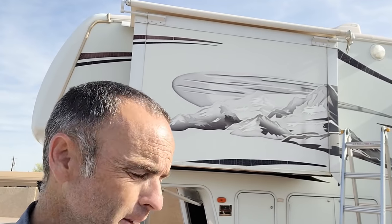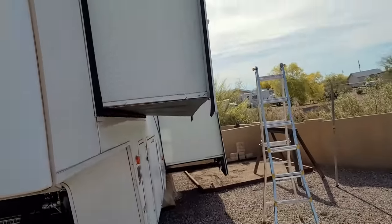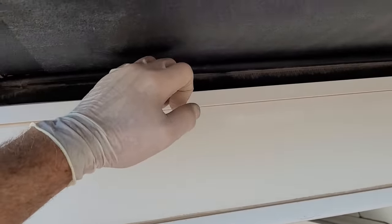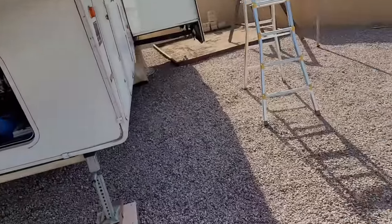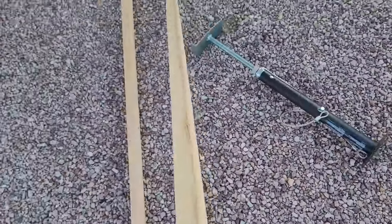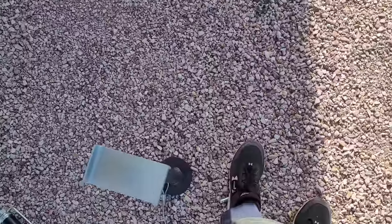I have a method here that I'm going to try in a mobile position, and it should work. In order to actually get this floor in I'm going to have to make some space on the threshold right here, because this is still supporting the weight of the slide-out. I need to get the weight of the slide-out off of this transom. I'm going to be using these jack screws and making braces out of this 2x2 — I'll basically screw this into the slide box itself where those screws already are, then use a jack screw to lift the whole thing up, kind of like making stilts for it to stand on.